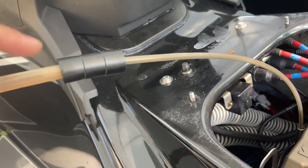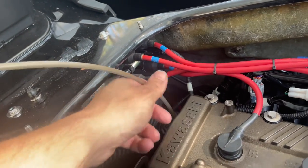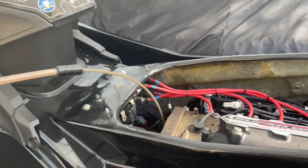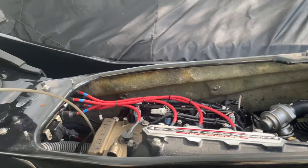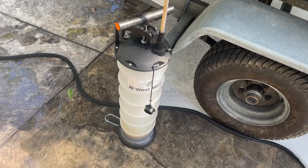This has got a steel cable within it to keep it holding its shape. I warmed up the oil — it helps it extract a little easier when the oil is a bit thinner. When it's warm you want it to circulate through the engine so you can extract any contaminants that settle in there as well. It's extracting pretty quickly with just a few pumps.